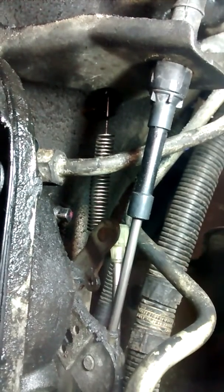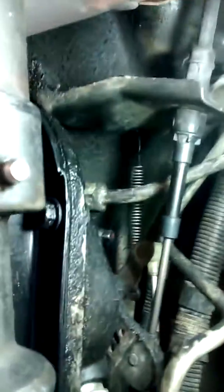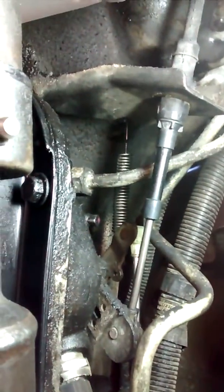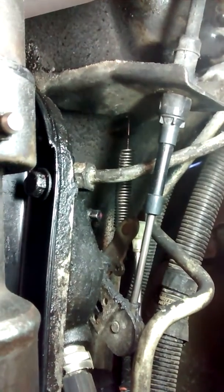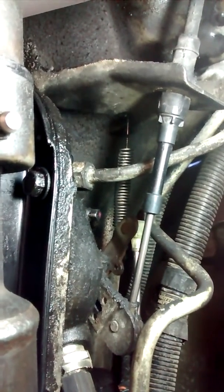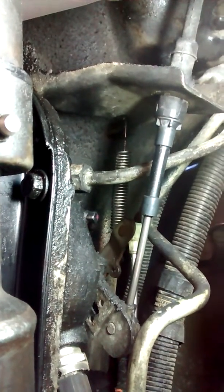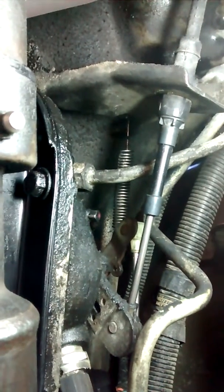If you have any questions, go ahead and leave one in the comments and I'll try to get back to you. One thing I forgot to mention: when you do the torque to 72 inch-pounds, the first time I would torque past that point - maybe a half turn past - then back off a full turn and come back at it again and retorque it exactly to where it should be. Then take the socket off, look and see where your dot is, back off again a full turn, come back at it again and make sure the dot matches up between the second and third times.